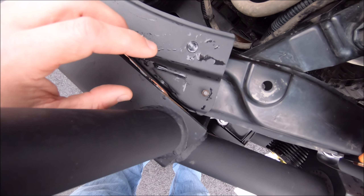I took that piece off — one bolt on the passenger side, two in the middle, and one on the driver's side. I used deburring bits, which are fantastic for small grinding and smoothing projects — about 10 bucks with all kinds of different size heads. I marked the area with a marker, cut it down, and while the piece was off I went ahead and put a fresh coat of flat black enamel on it to keep it looking nice.